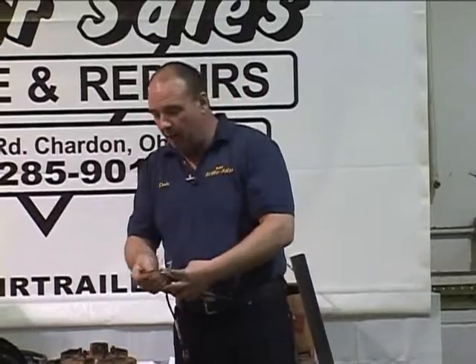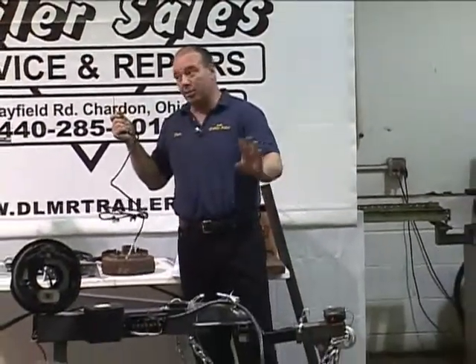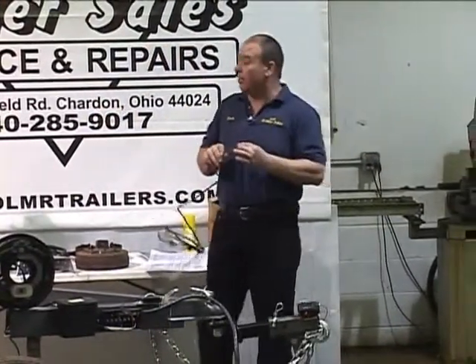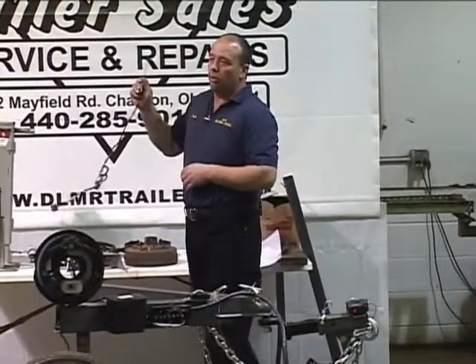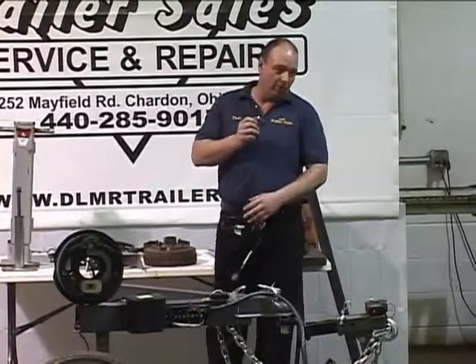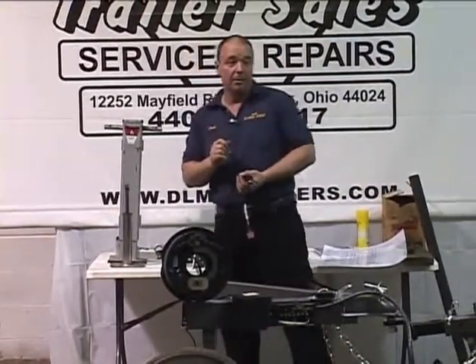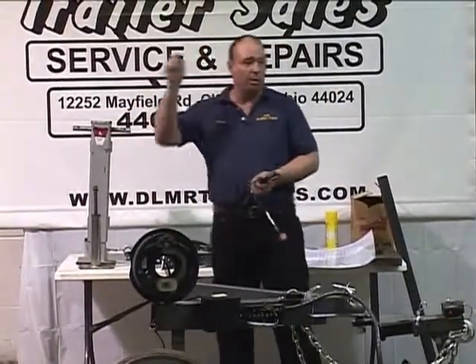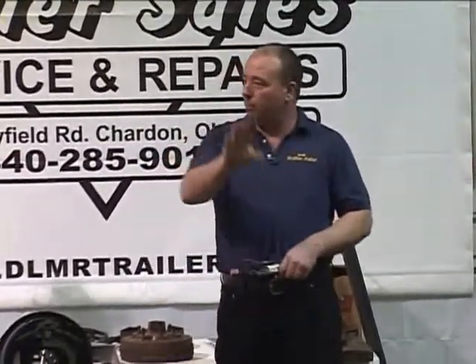This is a GM brake box lead, which is no longer used in 2008 and newer. General Motors now supplies wires taped up underneath your dashboard — find them. You're going to have a red wire, which is your power lead. On your brake box, the black wire is your power lead. Ford actually color codes; GM does not. You'll find that red wire and put it all together, and the brake box will not work. You've got to go under the hood and locate the wire that goes to your outside fuse box, which is taped in your wiring harness somewhere. Don't call General Motors — they're going to tell you they don't know where it's at. After you find that wire, you may need to find another wire if you have a separate light circuit. Some of the Fords require relays, but they give great instructions.